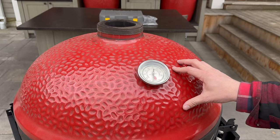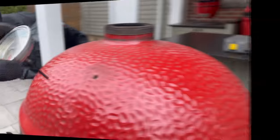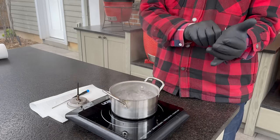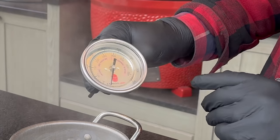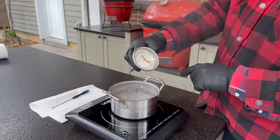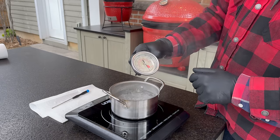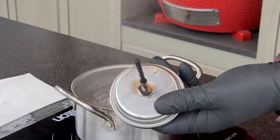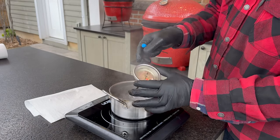Spring and fall is a great time to check calibration. Let's pop open our dome, remove the wing nut on the back of our temperature gauge, and slide it out. To calibrate, I've brought some water up to a rolling boil. I'm using high-heat gloves along with latex so the water doesn't pass through and burn me. We're looking to bring our temperature gauge exactly to 100 degrees Celsius or 212 degrees Fahrenheit. On the back there's a standard flat-head set screw for adjustments.